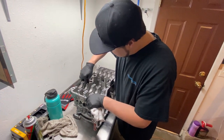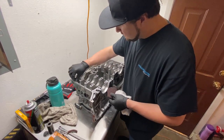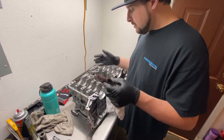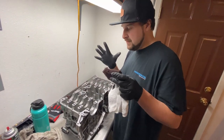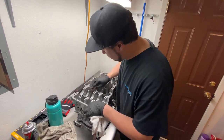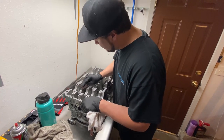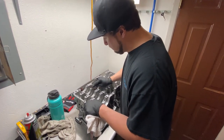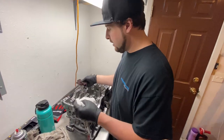Keeping things clean, getting things fitting right, checking for burrs on all the edges — all these little edges, you want to feel for burrs and nicks. Any nicks in this mating surface are crucial. When the cases are bolted together, any burrs or imperfections are going to create uneven clamping, warpage, and it's not going to seal properly. It's going to affect your main line because these blocks are sandwiched together. With a used block, we have no idea what the previous builder did or what the clearances were. So we have to assume everything is bad in order to address all the issues.